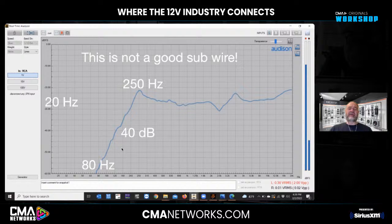I think this was out of a BMW with bass audio, this particular signal capture. And you'll notice if you look in the lower right that this left channel is bright red. The reason that left channel is bright red is that we're actually into clipping the input. That's the indication that you get. And if you look up here at the upper right, you'll see an indication that the left channel is clipping. That tells you you're running too much voltage in and you should back it off or flip the switch on the top to speaker so that you can use different attenuation.